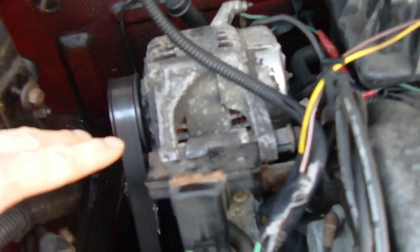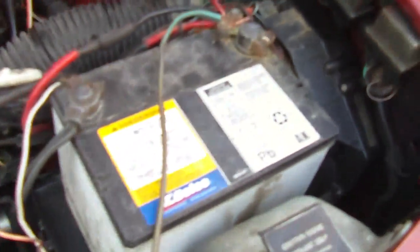I mean, of course you could just replace that alternator there with one with a built-in regulator. I didn't have one that would mount up the same as this, so the alignment would be out. It's not so easy to match up an alternator with the serpentine belt setup. This V-belt here is really easy, and to tension it, I can just adjust the idler pulley there for the air conditioning, and away you go. So it's working well. I've driven it around, and you know, everything's free, so that's why I did that, because I didn't have to buy a module or anything. Like I said, the modules are not so easy to find anymore. This is an 87, and usually if you find one, it's burned out.